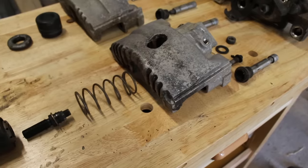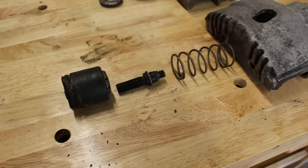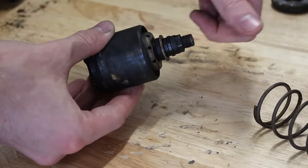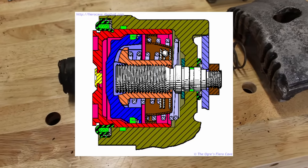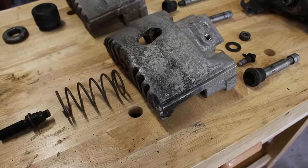The rear ones are where it gets really strange. It's still typical piston mechanics for normal braking, but for the e-brake, it makes use of a lead screw that pushes the piston outward when the cable is actuated. Not only is there a spring inside the cylinder, but there is also a spring inside the piston itself. This is all super weird stuff, but it's probably just because of all the cocaine from the 80s.